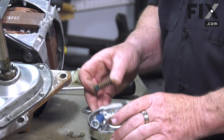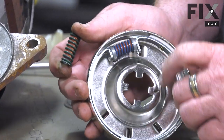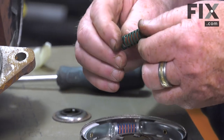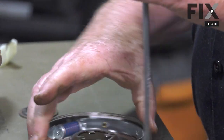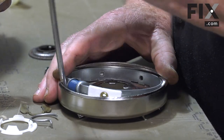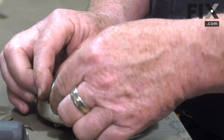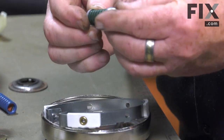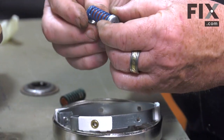Your clutch will come with a new clutch band and a new spring inside. The blue spring is used for a full-size automatic. If you have a different machine that uses a green spring, you'll want to swap it — it's pretty easy to do. Just pop your clutch band out with a screwdriver, separate it, change your spring, then reinstall the band. But for this size washer, you want to go with the spring that was already in it.